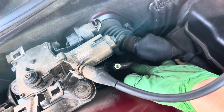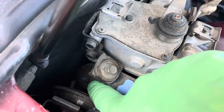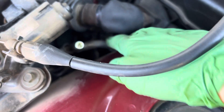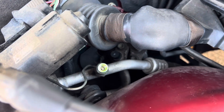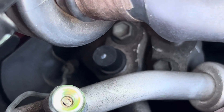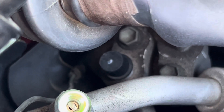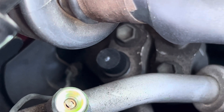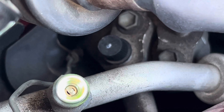You can see it's attached to the wrong side - again, this is really common. I always show you guys this: the suction line going to the compressor, but the POA valve is located right under the cruise control. Over here you might have 5 psi or 10 psi - that is normal pressure on the suction line. But see that second cap buried way down there where you almost can't get your fingers to it? That is the evaporator suction line - that is the evaporator pressure - that is the correct port to hook up to.